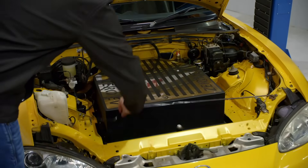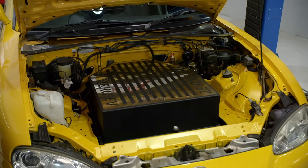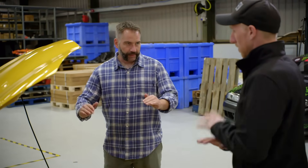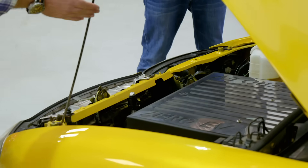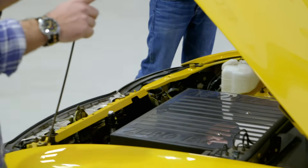Oh, that's your battery pack. In my mind I'm thinking that looks like a heavy bit of kit. You've definitely had to upgrade the suspension on this to make it ride like an MX-5. Done nothing. But look at it — it's a big, heavy, metal-looking box. So you're saying that makes no difference? Makes no difference. And the reason it makes no difference is that Chris designs his kit to roughly weigh the same as the mechanical elements it replaces.